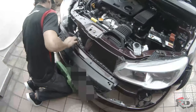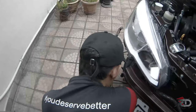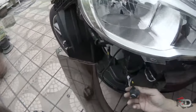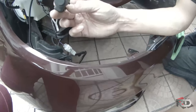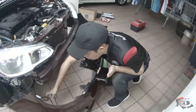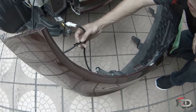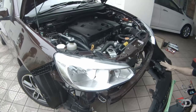And one more. This is the accident — when you don't take out the sensor cable first, the whole sensor will come out. But no worry, you can still fix that. Just remember: don't force the bumper to open first — you open the clip first. Now the bumper is done for dismantling.